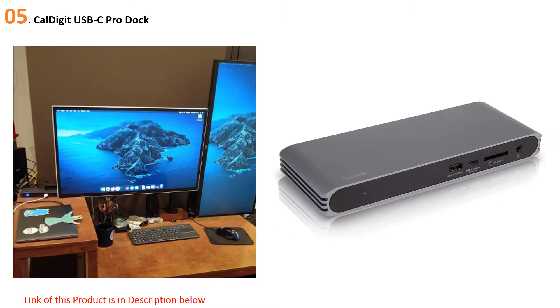The main advantage of the USB-C Pro is its compatibility. Thanks to its USB-C support, it allows you to connect computers that don't have Thunderbolt 3 capability. The USB-C port also supports dual FHD displays or a single 4K monitor at up to 30Hz refresh rate. Furthermore, the Thunderbolt 3 port can handle dual 4K displays at 60Hz.